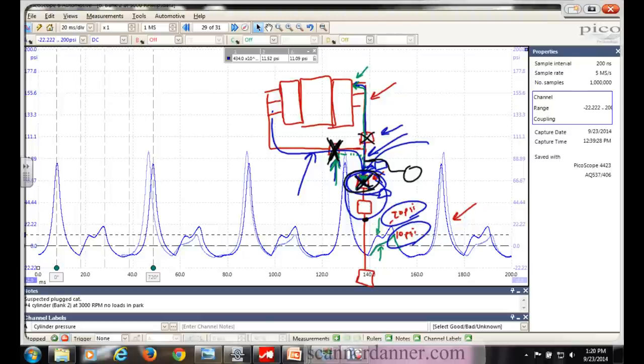This could be the difference of five hundred dollars - if you're thinking about, say, a single mom with a bunch of kids. Is there a way we can be a little more precise? One of you guys mentioned measuring tailpipe CO, and so we're not worried about whether the cat is functional here - we're worried about flow. Those are two completely different things.